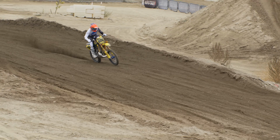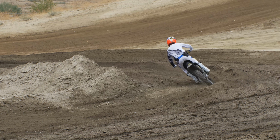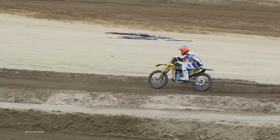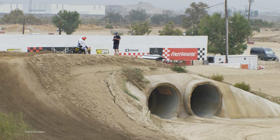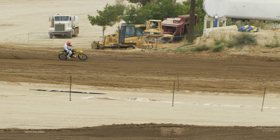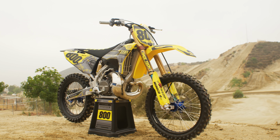ESR was able to keep the price down on its YZ325 big bore kit by designing its own custom power valve that's regulated by exhaust pressure instead of traditional linkage and governor design. With this design, Eddie Sanders Racing is able to go bigger when boring out the cylinder and doesn't have to worry about manufacturing all the standard Yamaha YPVS power valve parts to compensate.